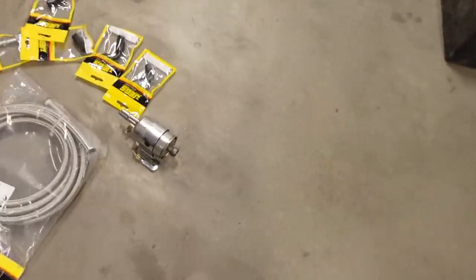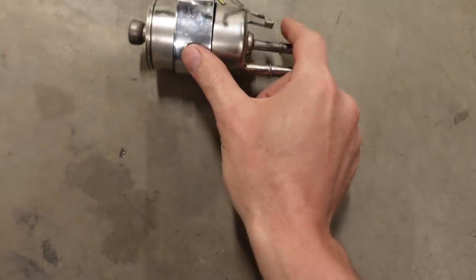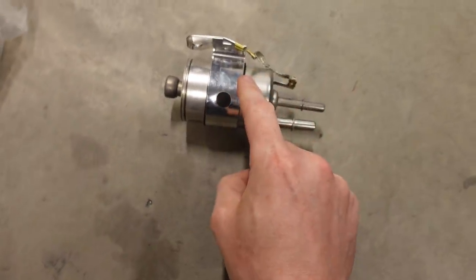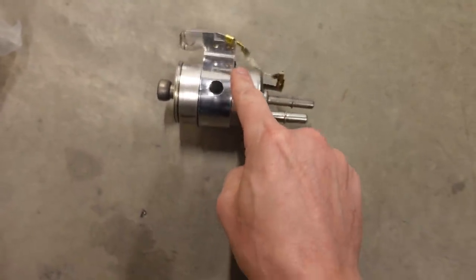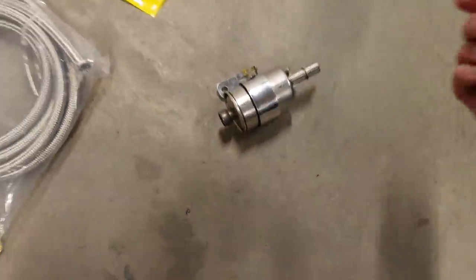And we're going to be using a Corvette style fuel filter regulator assembly, which is very common in LS swaps. I've got it right down here on the floor. So more or less, we've got two lines that go into here. One is a feed, one is a return. There's also a filter and a regulator assembly in here, so this does two functions. And then a single line is going to run all the way up to the fuel rail or the engine